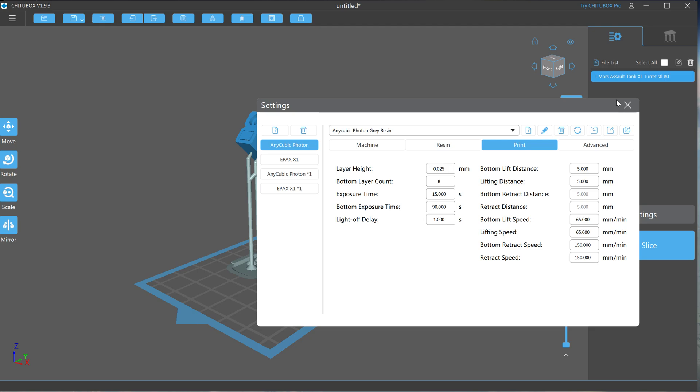To expand on that, in order to update the firmware on your printer, you just need to download the update file and make sure it's compatible with the device you have. Some newer Anycubic resin printers are not compatible with the old firmware, and some older ones aren't compatible with newer firmware updates. How it works is you select the firmware as if you were going to print it, hit select, it'll update the printer, then turn on and off, restart, and give you a message saying the firmware was updated.